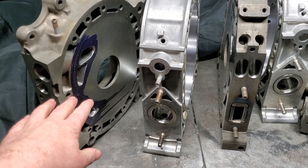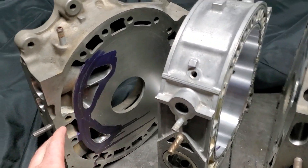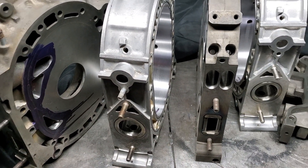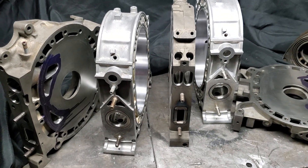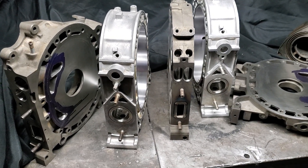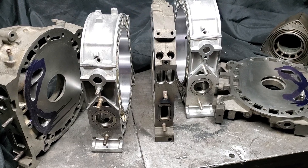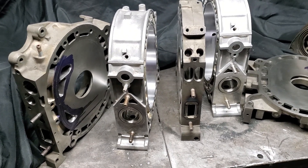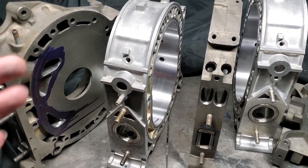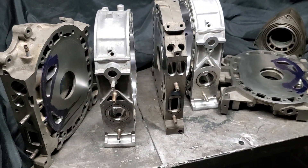The porting's not 100% done. I've still got to do polishing and a little more work, but it's fairly roughed out, and a few people noticed I did have the bridges drawn on here. For me, I lean towards the street port. It's going to provide great bottom end, great response, great drivability, mid-range horsepower, and at least up to 9,500 RPM great volume flow and great horsepower. That's what we've always done in the past. I am considering a bridge, as so many people have asked about how that performs, so if people want to comment, I'll take it into consideration.